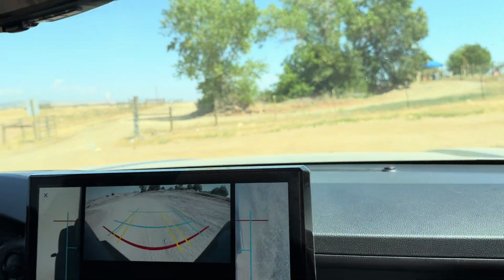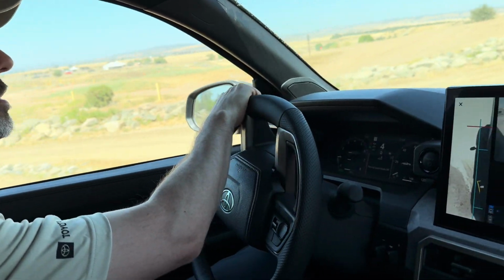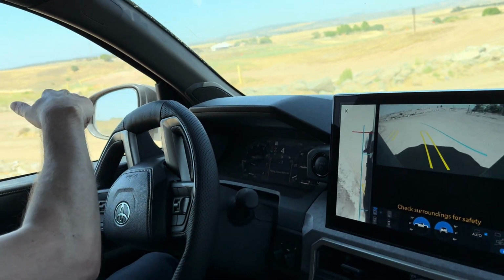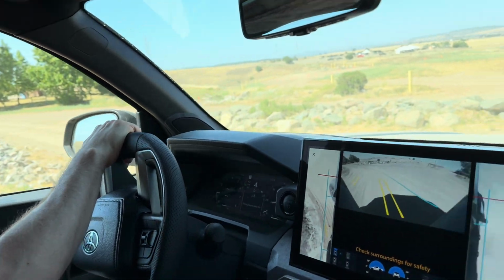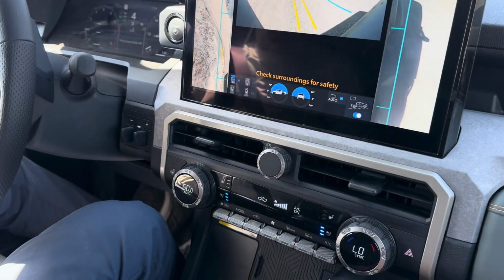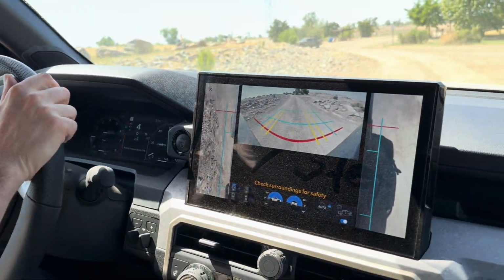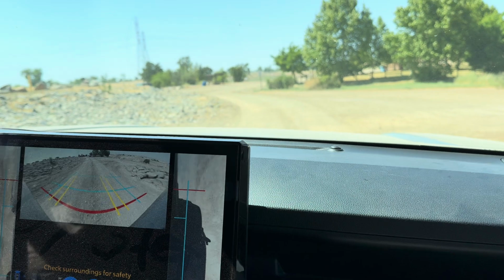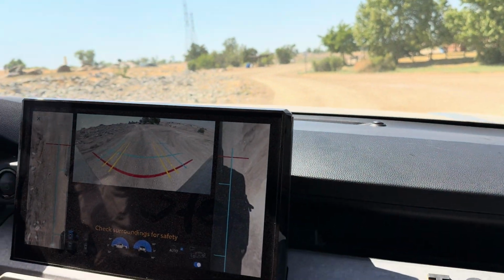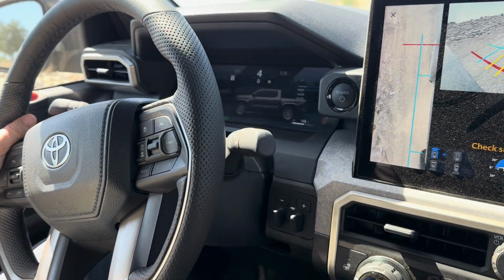So this was smooth, right? I didn't have to do anything, just enjoy it. I'm going left, right? Yep, left. We're going left here. Let's go ahead and unlock that rear differential now, so press that lock button there. Okay. Now that we're out of the sand, we're going to change that MTS mode and go to MTS Auto. Just rotate that to Auto.